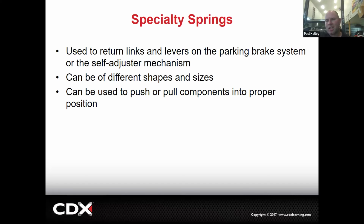But the important thing is a spring is made of spring steel, which is made to basically hold its shape, and you can deform it and it should come back. You can only do that so many times before the spring becomes fatigued. It's kind of like springs on an old car. If a car's been carrying a lot of weight for a lot of years, you notice it starts to sit lower and lower and lower. The spring steel is wearing. So, general rule of thumb